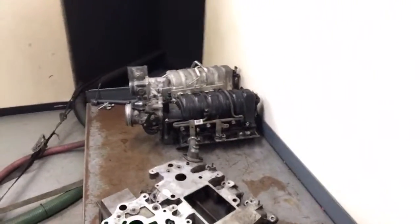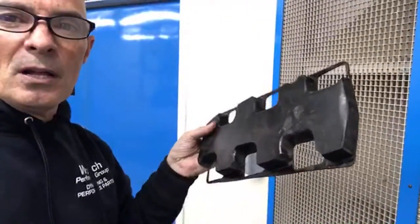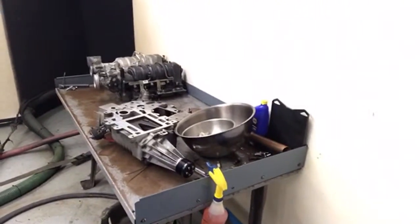So I ran those two intake manifolds, and then the one that's on there, and then the ones with these inserts, and these things actually work fairly well. You know, naturally the short runner stuff lost power down low, but they did pretty well. And I think ultimately that might be what I would like to run. Although these want to run a little bit higher peak engine speed than even the short runner versions of those, but those seem to make a little bit more power. And then the throttle body wouldn't be a restriction, because we're running boost through it, so that's not a big deal.